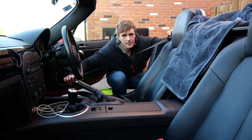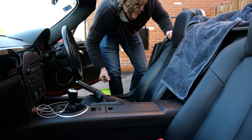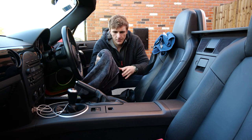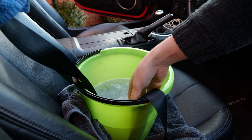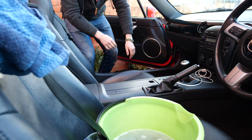Here's the sticky seatbelt on the driver's side - as you can see it's fine till there and then it gets stuck. I'm going to clean the whole thing and put the mole grips on to stop it self-retracting, and put a towel down on the seat to protect it. I'm giving this a proper good rinse - it's very soapy and it's actually already gone a lot softer. That water is going dirty very quickly, and the buckle fell in - not sure if it matters or not.